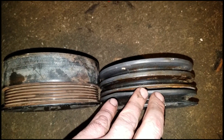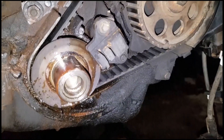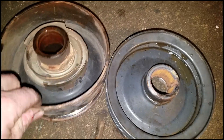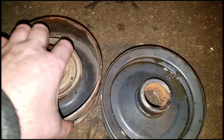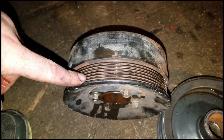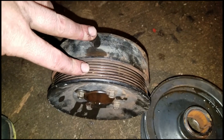The original plan was to use the Bayliner alternator because it's a lot easier to fit into the engine bay. But then I was looking at the motor and noticed a crank position sensor for the fuel injection. We obviously need to have the correct balancer — this one has the little tabs that the sensor reads, and the boat one does not. So what we're going to have to do is keep the existing alternator bracket, which means we're going to have to cut some of the boat away to make it all fit. Honestly, I'm okay with that.